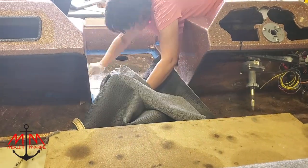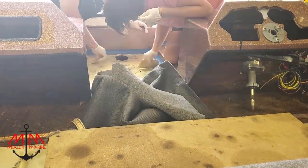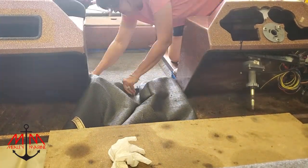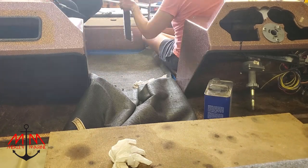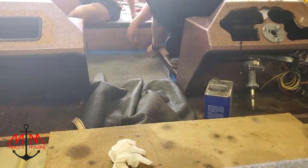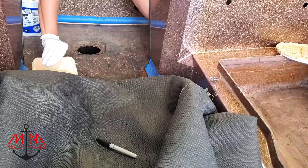The most important takeaway from this video if you want your carpet to look professional and very clean: change your razor blades out every one to two feet. Flip it over and then get rid of it. If you want fresh carpet that looks ultra clean, always change out your razor blade.